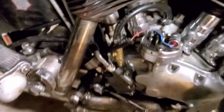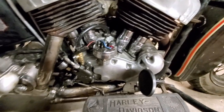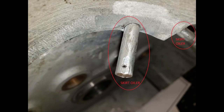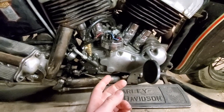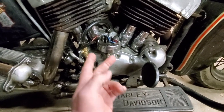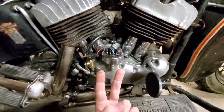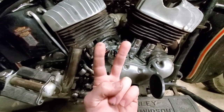I got this idea from Dick Lynn — I'll try to throw a picture or something in here of kind of what I've done. I have skirt oilers that I added to the case, and oil is fed to them through this hose here. The idea is to spray oil to help keep everything nice and cool — they spray oil on the bottom of the pistons.